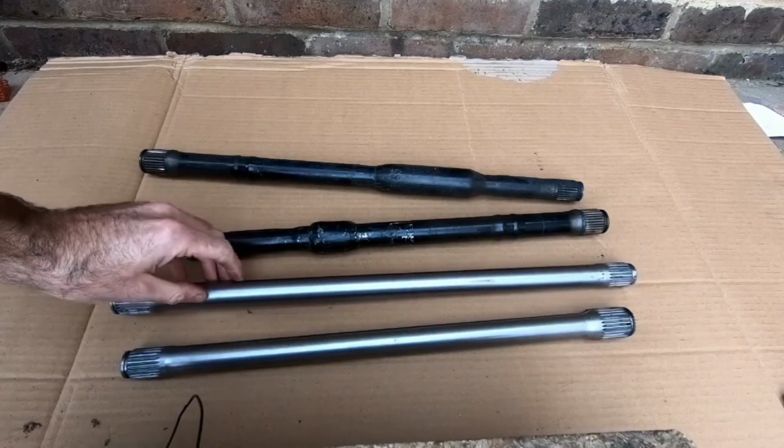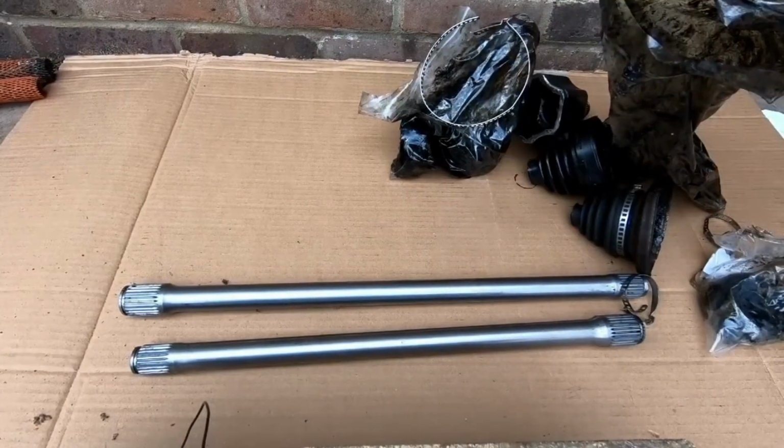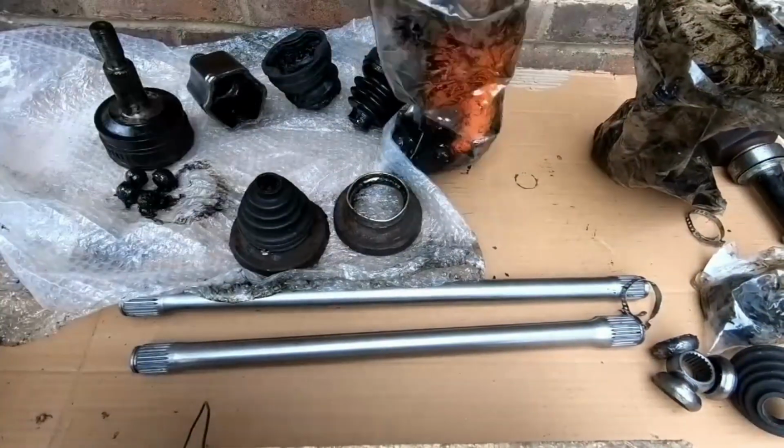And at that point, a parcel landed on my doorstep which had the drive shafts that I'd sent away months ago. I made custom drive shafts back in 2019, and while they were fine for driving around the driveway, ultimately I wanted proper, 100% drive shafts that I could be happy with. I didn't want to have to worry about how much power I was going to put through them if I eventually get to the stage of driving on the road. So I got a company to take the drive shafts that I'd made and mimic them, but as a single piece of hardened steel, and those came back to me. I'd sent them the parts as an entire drive shaft, and they had to take that apart in order to make them. So what came back to me was a bit of a puzzle that I had to figure out how to get back together.